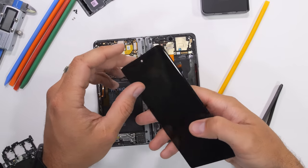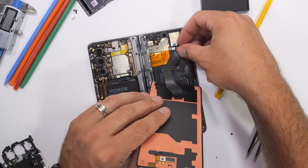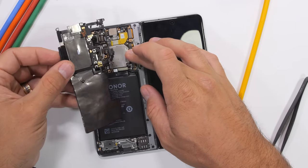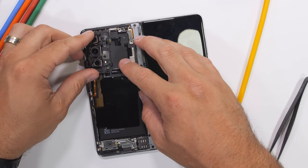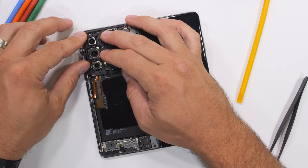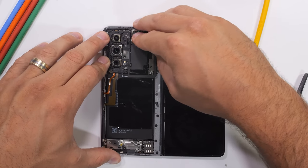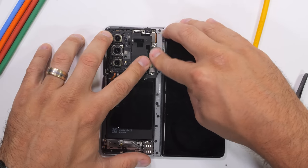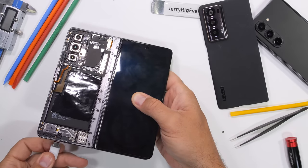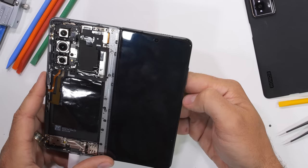The upper motherboard is also where we plug in the 6.4-inch front-facing 120Hz screen — I won't stick it down just yet though. The rear plastics for the back of the folding phone are doing double duty here, as circuit board protection as well as holding the camera modules in precise positions so they can all work together, seamlessly changing from one lens to another inside the camera app. With the phone mostly assembled, we can try plugging it in — and look at that, signs of life.